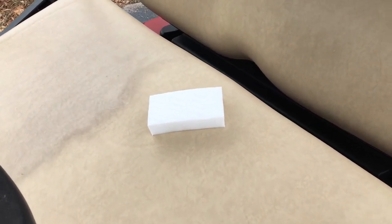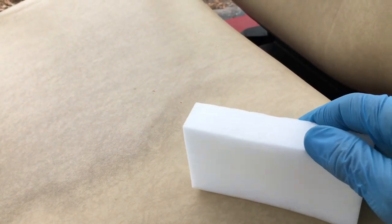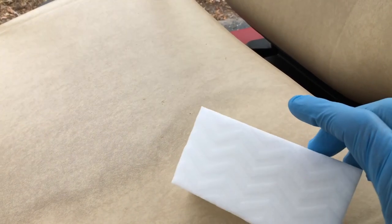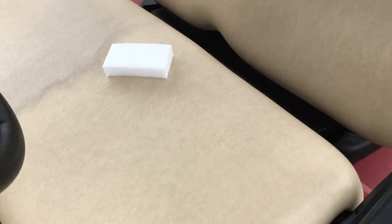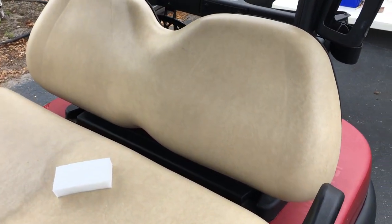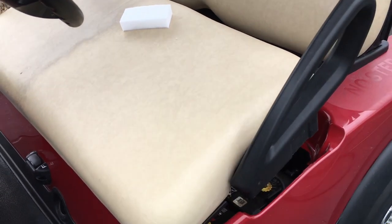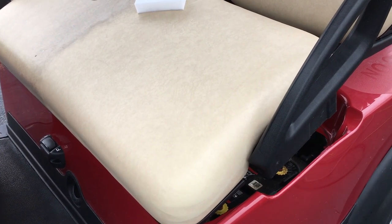The trick for vinyl — vinyl is porous, which is why it just mildews and literally holds dirt. So a cleaning sponge, this dense cell-count foam called a magic eraser, with a little bit of detergent or some ammonia, will pull the dirt out of the porous surface. We're then going to seal that with satin. Once it's sealed, that porous surface will no longer hold on to dirt, mold, and mildew. It will stay much cleaner, require much less effort in the future, and of course maintain value.